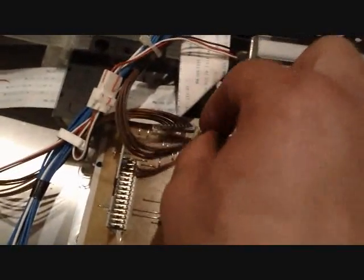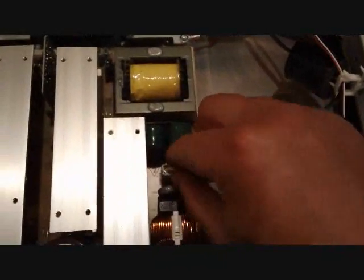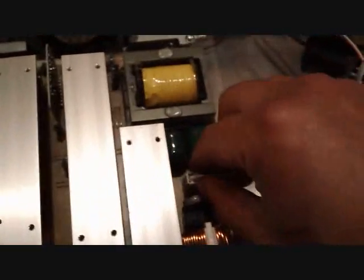These two plugs you just carefully wiggle and pull straight out. This type of plug here is the same. This one is a locking plug — there's a plastic tab and you have to push on the side of that tab, then wiggle and it pulls right out. That's number four. And then you've got the main AC feed — this is where the 120 volts comes in to the power supply from the little board that has the standby switch, surge protection, and a line fuse. Pop that one — that's number five.